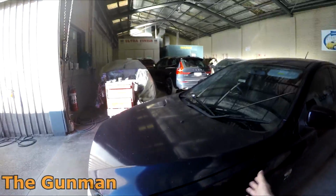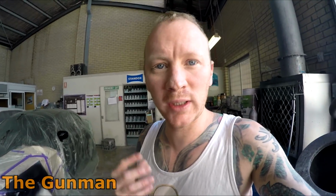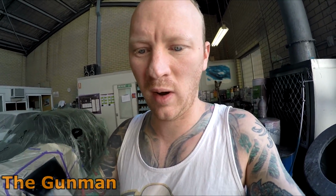But what ends up happening, say you're spraying here on this guard, it'll just float all over, and you'll get your color all the way over the front edge of the adjacent panel, and effectively you're not even blending anymore. So basically I've quizzed them a little bit more this time about pressures and all that kind of stuff, and asked if I can lower the pressure, and they're like, yeah, you can.